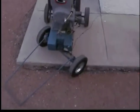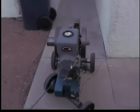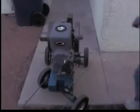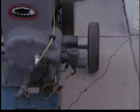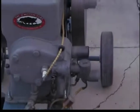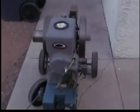It fell off the sidewalk. Okay. No, it actually, they should hold it with the wheels at an angle like that. See, the faster he fires it, the less you can see the smoke, but it's still misfiring. But actually, it seems like it's almost firing. It might be so rich that it can't burn all the fuel. No, that's true.